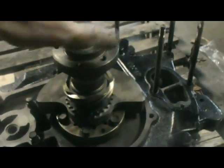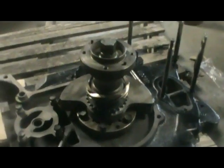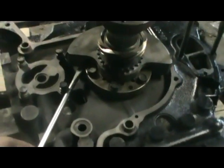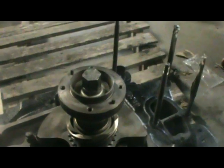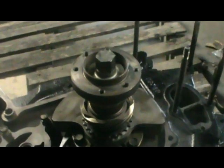Then next is just the hub boss thing — slide that over too. Then the hub bolt. I'm going to tighten this down. You get a screwdriver and stick it in there so when the counterweight goes around you can stop it and torque that down to 90 foot pounds. Then I'm going to set up the dial indicator and check the end play.